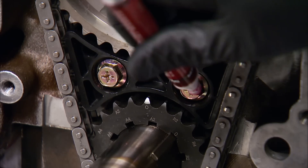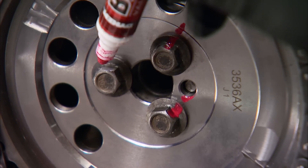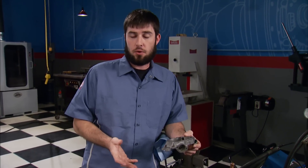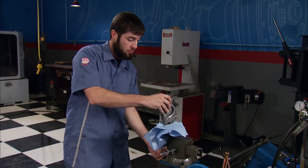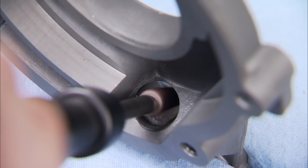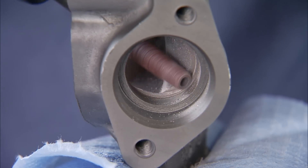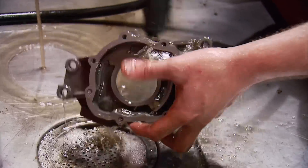Here's a tip that won't cost more than about $5 but can save you thousands: if you stop during assembly and come back, after torquing a bolt put a little line on it. It's an instant visual to confirm what's been torqued, and if the lines have separated when you tear the motor down, you know a bolt has moved. Since the oil pump is the heart of the engine, we'll knock off any sharp edges where oil enters and exits the pump to give the oil a smooth flow path. When using a grinder, don't apply a lot of pressure or RPM — let the cartridge roll do the work and guide it to make a smooth radius. Then wash the housing and it's ready to go on.